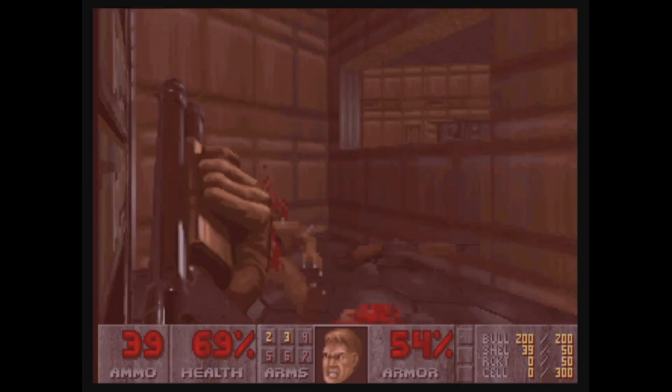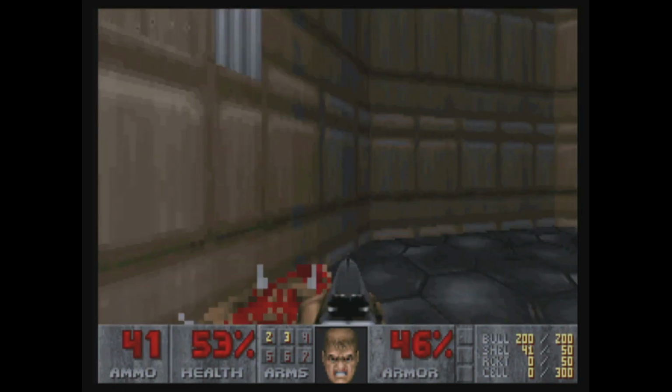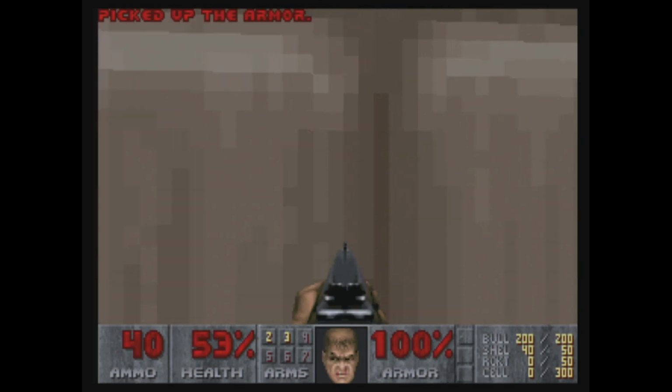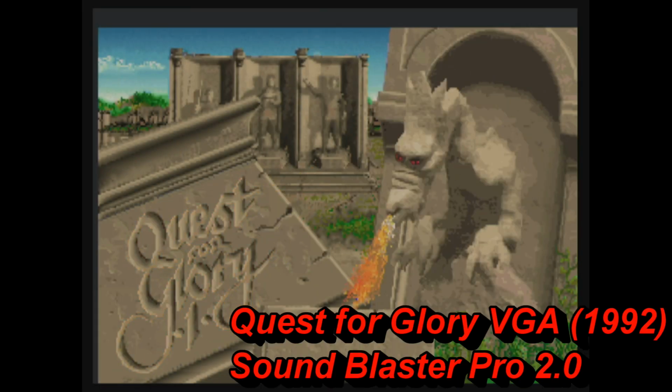So before we look at benchmarks, there's a couple issues that I have to bring up. First, we have to verify, and using check CPU, we can see that the CPU is running at the correct speed and is running in write-back mode. Unfortunately, I cannot get the machine to work in write-through mode to compare speeds write-through versus write-back with this motherboard.